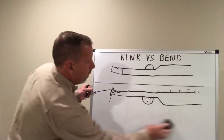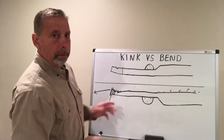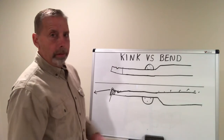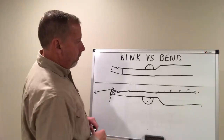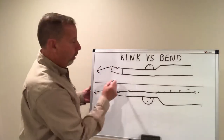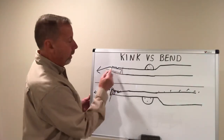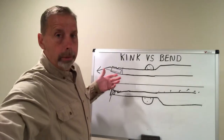All these kinks and buckles — let somebody else make that decision. There are a lot of options out there. Maybe you can repair it. Insurance companies seem to say 'we're going to buy a used section of rail and just put that in there,' but most manufacturers don't allow anything used to be put on a car. If you do that repair, once again you're liable for it. The main thing with these videos is just to show you the procedure to pull on a kink or a bend, depending on what you've got, and the proper way to repair it. There's also that rail saver I've seen advertised — it fits in there and pushes that out. I've never used it, but it looks like it'd be a good product if it's advisable that you can repair that rail.